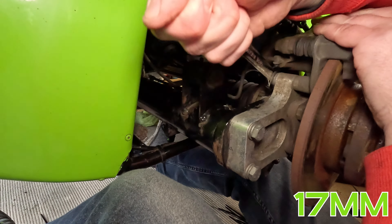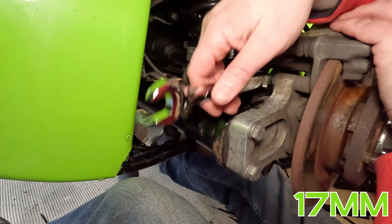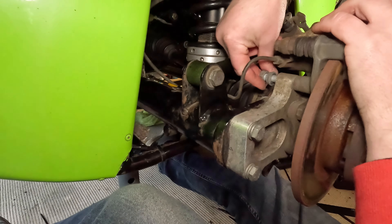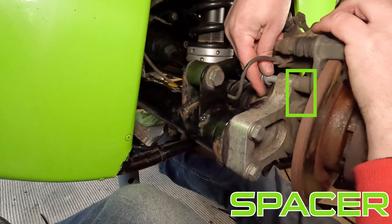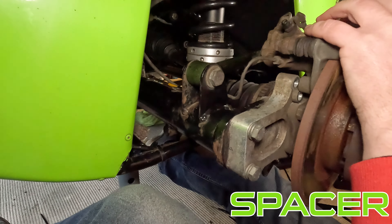The struggle was probably down to a few things — the rear brake pads and discs are really old, possibly the originals and about 10 years old. I could have taken the rear brake pads out to make this easier, but I knew I was going to be replacing them anyway. I ended up using the handle of my breaker bar to lift the calipers off, but it wasn't easy. I zip-tied the calipers to the rear springs to keep them out of the way. Just be careful, as the brake lines are solid and you don't want to damage them by moving them too far.